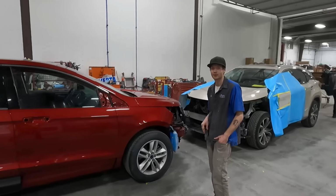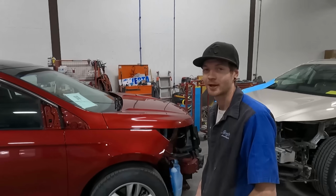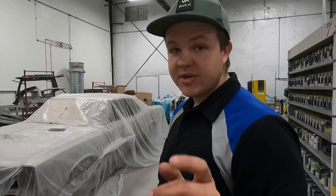Fresh. Third one I've ever done. Good job, Taylor. Happy with the turnout. Okay, to everybody else that doesn't know what RR is, it's ruby red. It is a tri-coat red from Ford. You put down your base coat, then you have to put a mid-coat tinted clear. So in the tinted clear, you put red, and then over top of that, you actually put your normal clear coat.